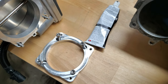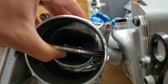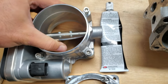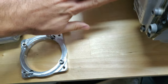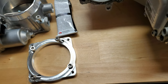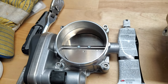Maybe use some gloves and get a rag — it can get a little messy the first time. Lastly, when it's all bolted on, you're going to be able to open up the throttle body blade and just wipe out any excess gasket maker. There'll likely be just a little bit, depending on how generous you were, but you really don't need much. It's going to be a very tight fit against there and on the adapter. Open up the blade when you're done, wipe out the inside, and clean that up — you'll have maximum airflow.